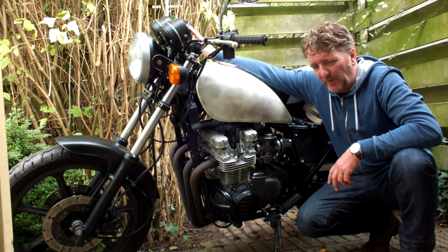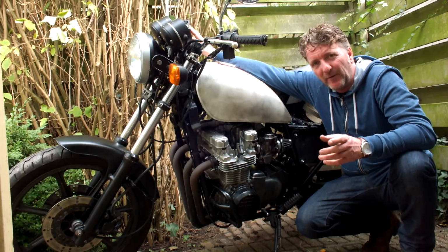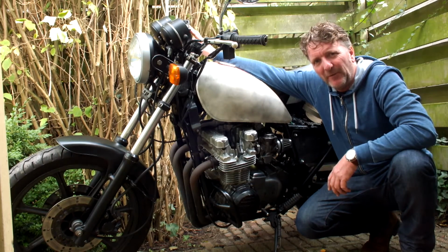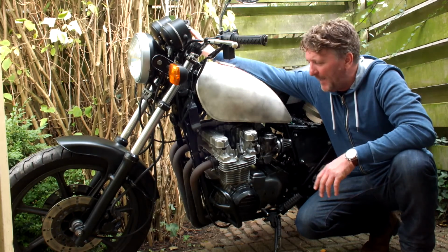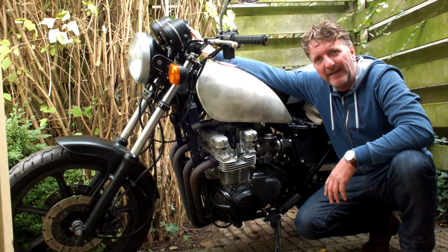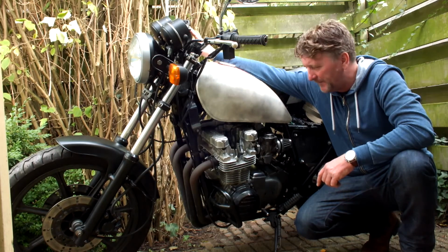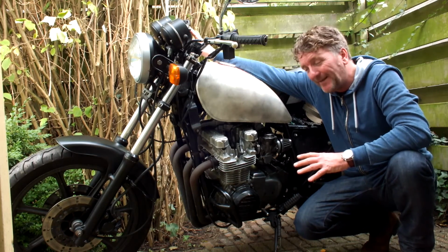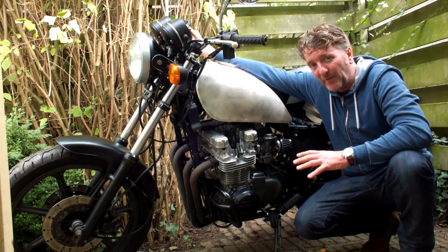So, you know, the lower RPMs, it's the pilot screw, and it's the slow jet or the primary main jet. When you get into the mid-range RPMs, there's a lot of influence with regards to the needle height, and when you get in the higher range RPMs, actually the secondary main jet is going to be the thing that's going to influence the performance. So in theory it's all understandable, but in practice then you need a lot of time and a lot of patience to get it right.